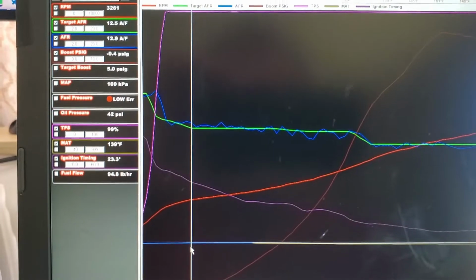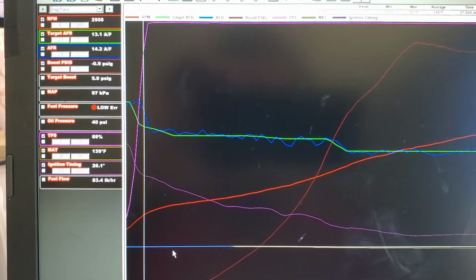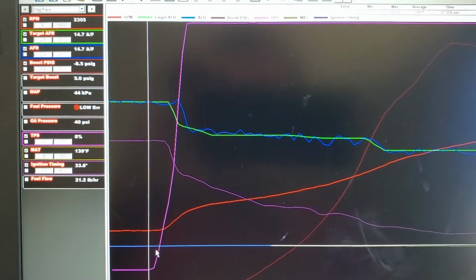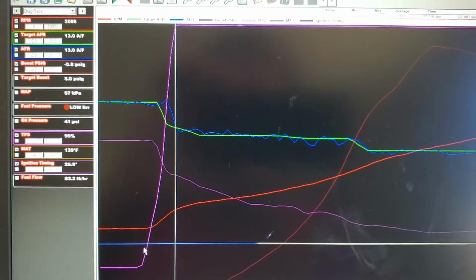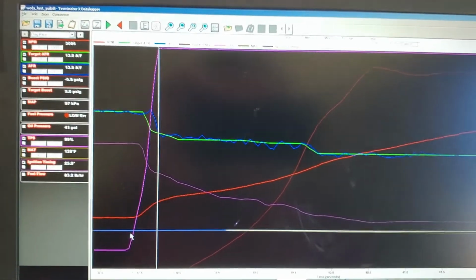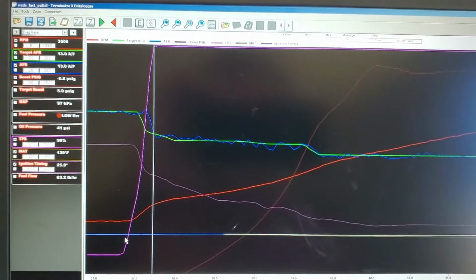So we started this run around 3,200, 2,900, whatever. Actually, I started it at 2,300, and by the time I was full throttle, it was at 3,000. Again, kind of a loose converter on this car, turbo 400, sticky tires on the back. None of these things add up to huge dyno numbers, but I thought it did pretty good, and it's going to be right on the street.